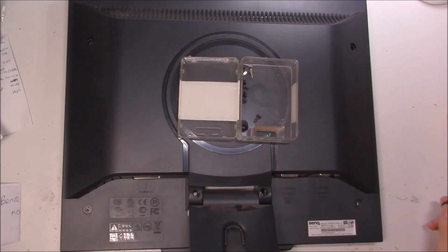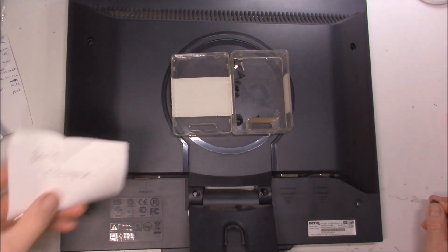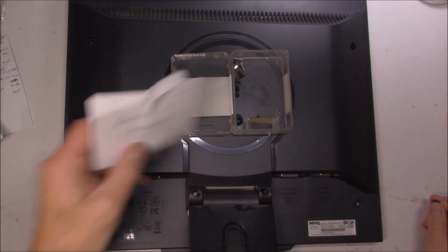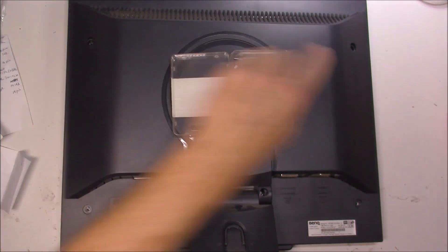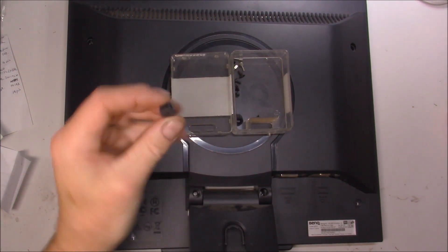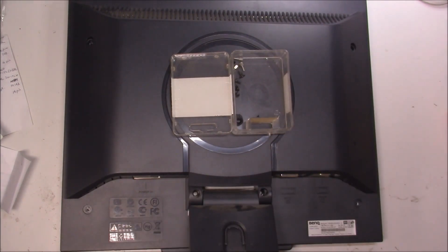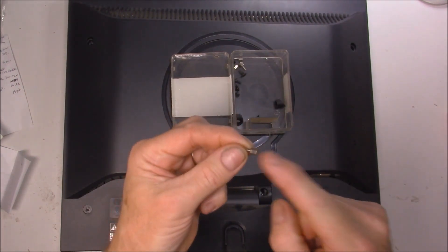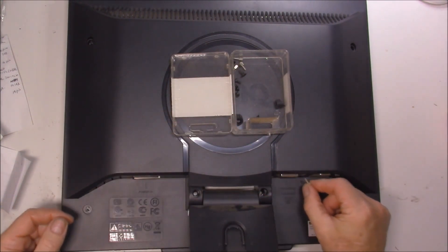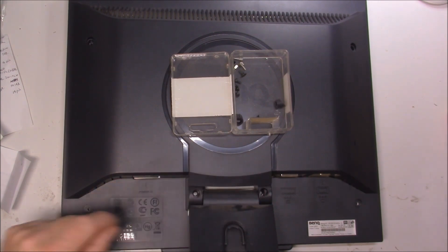To disassemble these, it's not too hard. I've got my little container here — always with my containers, I put what the item is so I don't get confused. Over here and here, you'll notice there are a couple of holes covered by rubber bungs. They'll need to be removed to access the screws hidden below. Also, you'll need to get rid of these VGA anchor points that go in here, and these two screws here.